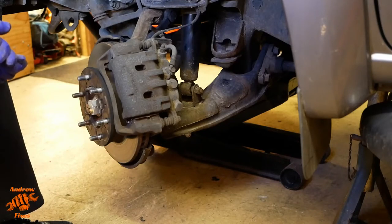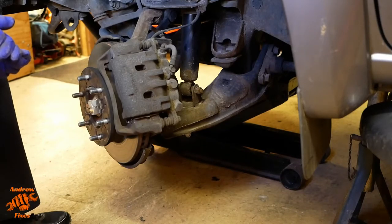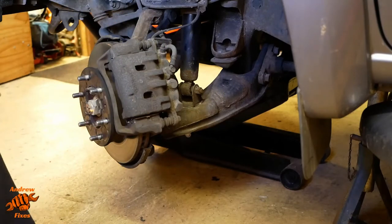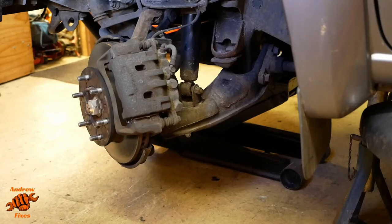That's the brake service pretty much done, apart from obviously taking it for a test drive, but we're not quite ready for that yet. The last thing to do — this caliper is still a bit loose, so just go and put your foot on the brake to seat the pistons back in place. There are two of them on this. Right, that's it. That's a brake service on a Mark III Ford Ranger — or at least a front brake service, or at least half a front brake service because of course you've got the other side to do. Thanks very much for joining me, I hope this was helpful. If it was, please give it a thumbs up and consider subscribing to the channel. Thanks very much for watching and I'll see you next time. Bye!